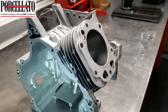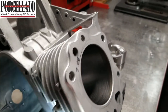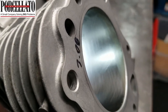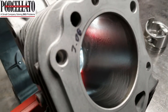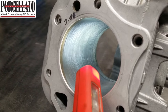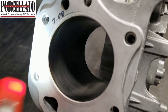This is the second engine I mentioned — the FE290 that was .5 mil over but well and truly beyond that. This is a little hard to show, but it was .25 mil and it was worn through the next oversize. You can see that little scallop at the top of the bore, and there's still a little tiny bit of a score in there that remained. Over on the other side, something similar — you can still see a little bit of witness from the top ring on the old .25 mil piston. It's only about ten thousandths of an inch, but that's how badly worn this cylinder was.